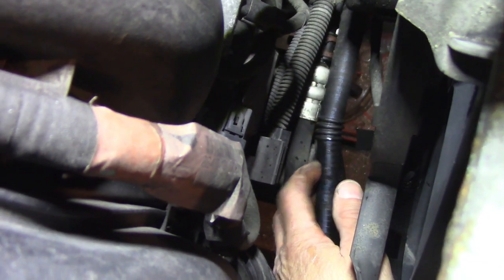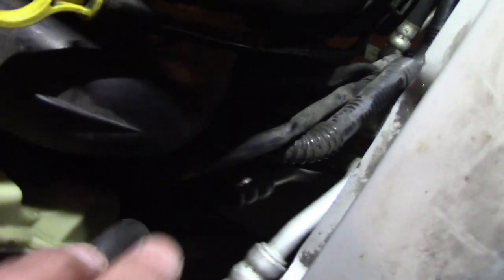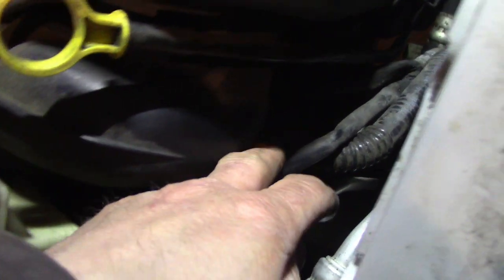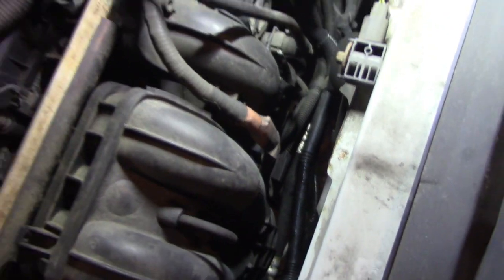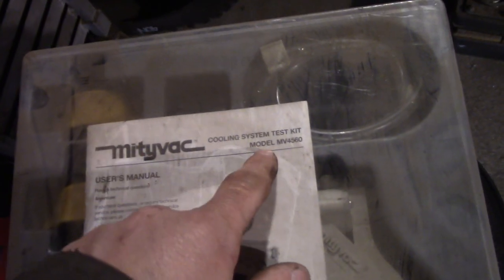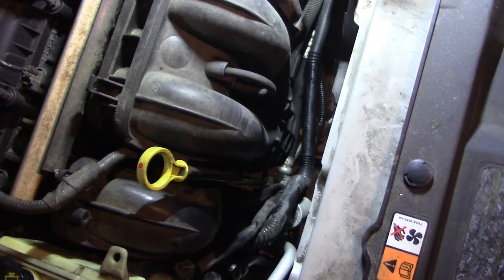This does feel like plastic, so we'll cut it here and here and do some kind of mend. Like I said, this thing snakes around - by the time it ends you're going to be frustrated. Even here it goes back in there; I don't know what kind of nipple it is, not friendly. That's the culprit. By the way, this pressurizer is called the Mighty Vac Cooling System Test Kit, model MV4560.